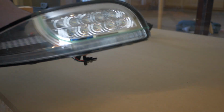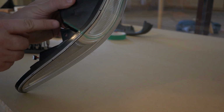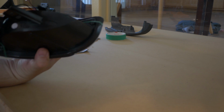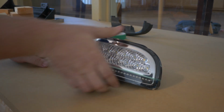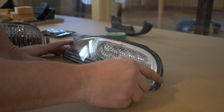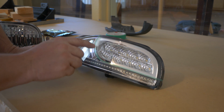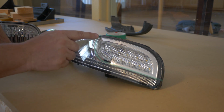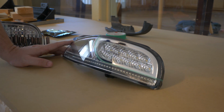Okay, but you can see I just ran that tape line and left a good bit of edge here. There's a special technique to getting good with this. But the key on the front side is when we lay the vinyl down, the key to making a nice cut is it has to be very tight to the surface. The vinyl, or tint in this case, has to have no air against it. You want it down tight against the knifeless tape.